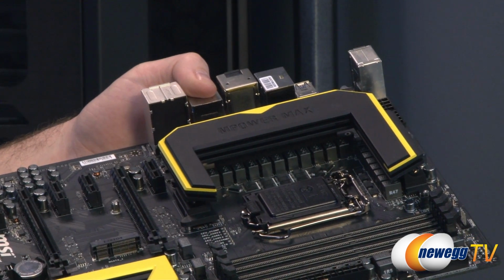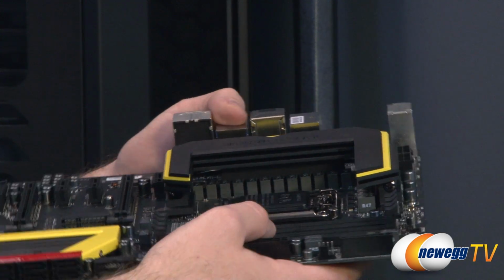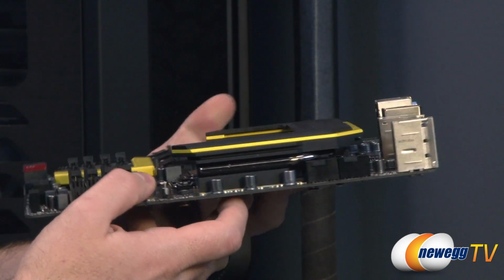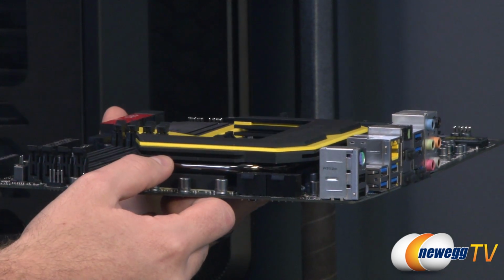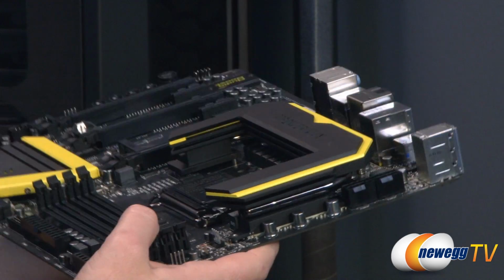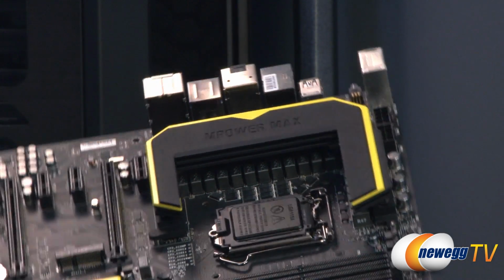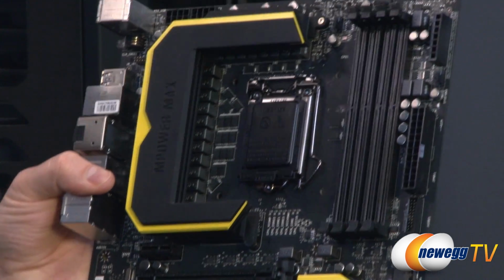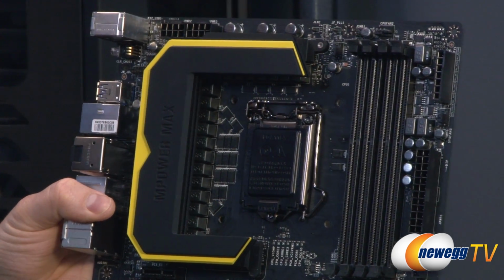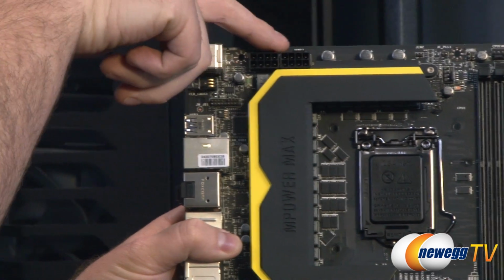This is definitely an overclocking centric motherboard. You have super ferrite chokes in there, as well as all the military class 4 spec componentry. And you'll notice you also have an 8mm heat pipe that's going sort of a full loop around this heatsink. That's just going to make sure that all of your power delivery stays as cool as it can, especially if you're getting into overclocking.